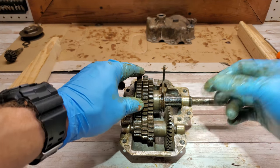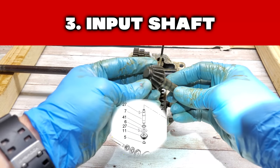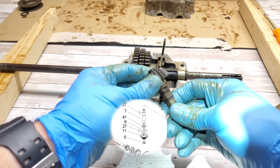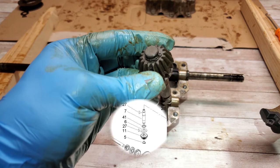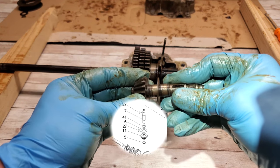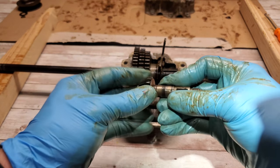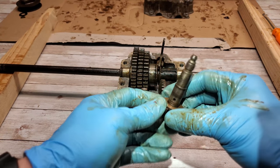Okay. So next thing will be the pulley shaft. I've already got that somewhat assembled. There is a snap ring on the top here, and a washer on this side. And it all sits keyed on this Woodruff key, which you can't see now. It's in the assembly. And there's another Woodruff key that goes on the top here. So I got that washer.